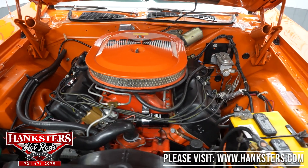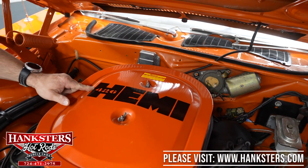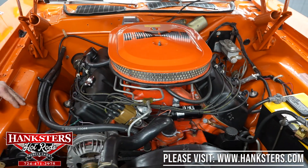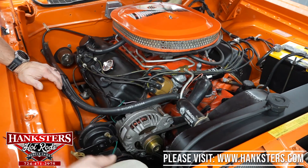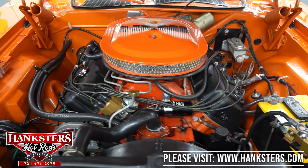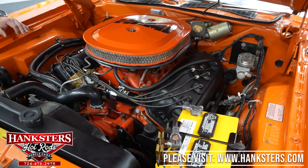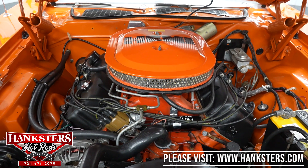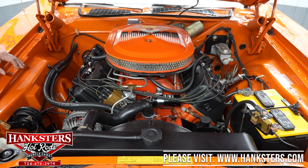You've got the 426 Hemi. You can see the air cleaner up here on top with the Hemi 426 decals on it — all looks to be in really nice shape. The other telltale sign that this is in fact a Hemi — you can clearly look at the valve covers and see your plug wires that go right down through the center of those valve covers. Underneath the air filter, we've got dual four-barrel carburetors — they are both Edelbrock carbs. The primary carburetor is a 1406 Edelbrock, and the secondary carburetor is a 1605 Edelbrock. Those are mounted on top of an Edelbrock aluminum intake.